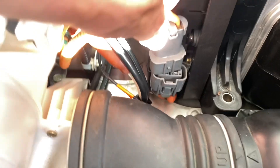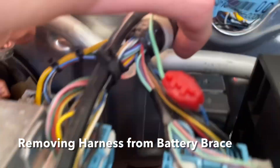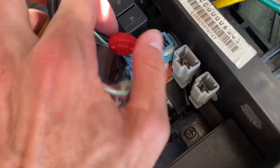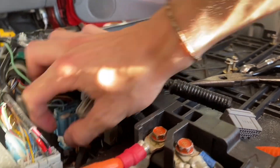I don't think I saw this in the other tutorial — maybe I skipped past it. You're going to need to remove this connector: just push that down and pull. I also just removed this white pop clamp from in this bracket and the brown one from that hole right there. I'm going to go ahead and disconnect this wiring harness. Ignore this red box — this is something that the owner of my car did. Eric Powers and I are trying to figure it out. He runs the G1 Honda Insight owners group on Facebook — very helpful guy. I'd definitely recommend reaching out to him if you need any assistance.